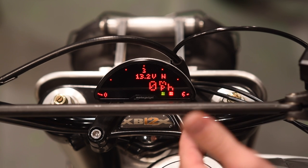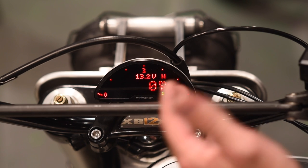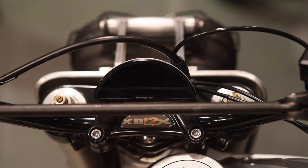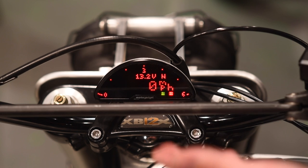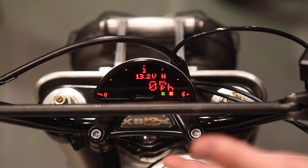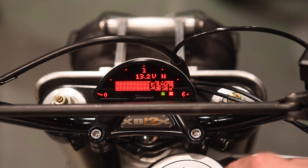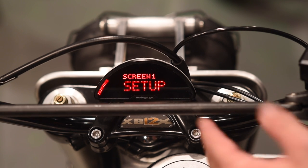What I've found with this gauge is that it won't enter setup after you've activated the gauge and started cycling through functions. So I'm actually going to turn it off first, give it a second to bleed down all the resistors and get a fresh complete boot. Turn it back on, and now without cycling through any screens, I'm going to enter the setup menu with a level four button push — any button push lasting more than four seconds. Push the button: one, two, three, four — and we're into the setup screens.